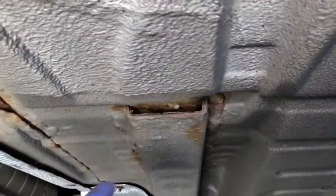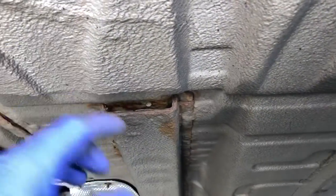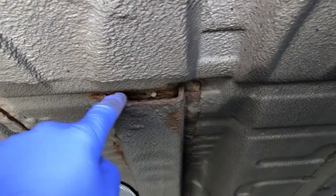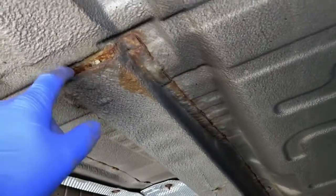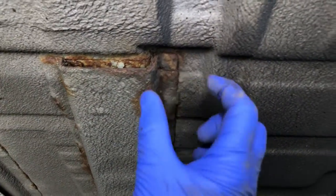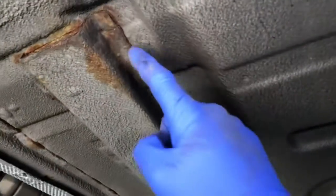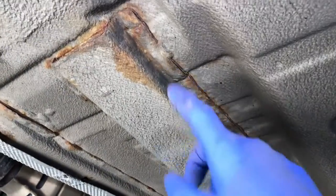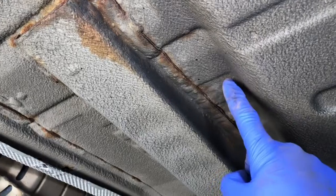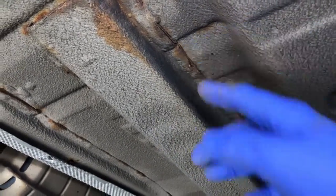But you can't get to it because it's spot welded together. Same thing if you look down this chassis leg — you can see it's a hollow section there. Even if you had a special tool, you can't even get a finger in, so you're not going to be able to take out all the corrosion inside that chassis leg. And you certainly aren't going to get any of the corrosion out which is on the contact patch — all the way down where the chassis leg is spot welded to the floor pan. You can get rid of the surface corrosion, but how do you get to it inside there?